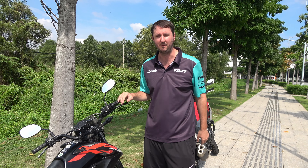The Honda XR takes one liter of oil. This is a bit annoying because Vietnamese mechanics have bottles of 800 milliliters, so they'll often charge you for two bottles to get that one liter — that's normal. The Honda Blade uses 800 milliliters of oil, so it's just one bottle, easily done. The Honda CRF250 takes 1.8 liters of oil — again basically two bottles. The Honda CB500X takes 2.7 liters of oil, which is quite a lot.